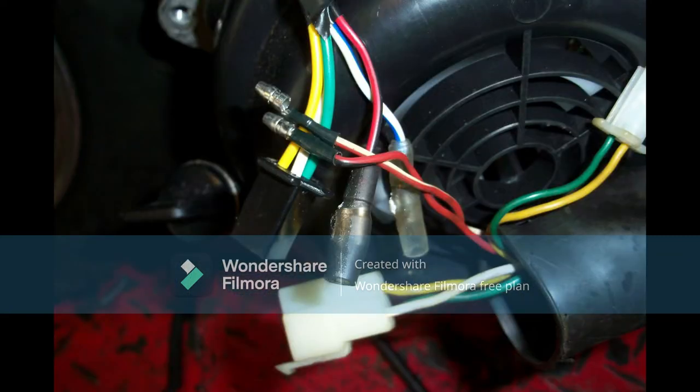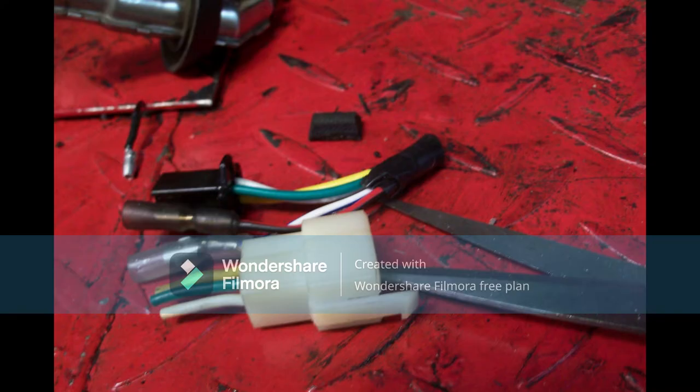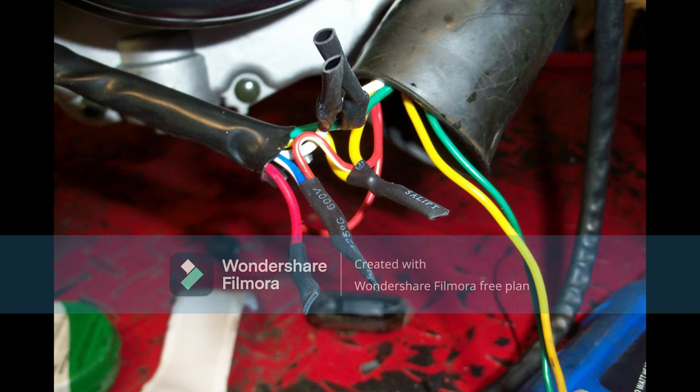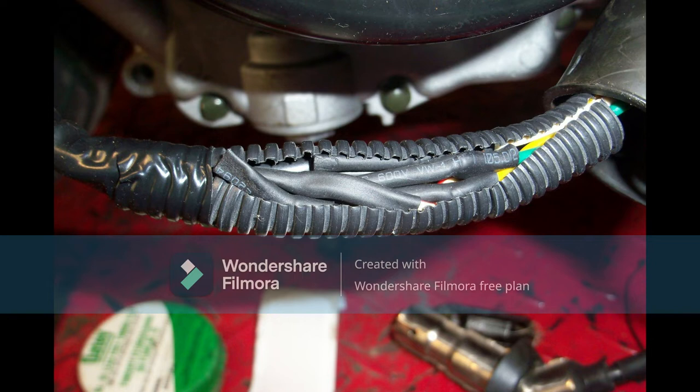Step 6: Make sure you have some knowledge of the Chinese scooter wiring harness. While all or most will be plug and play with regards to electrical, some stators use different connectors and some GY6 150 cubic centimeters motors are fitted with three-phase stators. None of the above issues are insurmountable, but some planning, careful research, and prior knowledge is required.